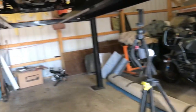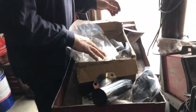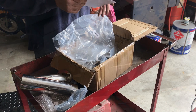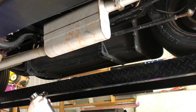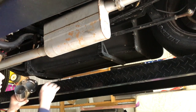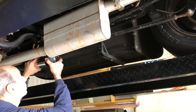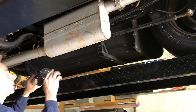This ends up going like that, and your muffler is still there. So you're going to be quiet or not quiet — open it up. It goes before the muffler. So we're going to cut the muffler here, cut this section out, put this section in it, and then figure out how much room we've got to tuck the little motor and the actual butterfly.